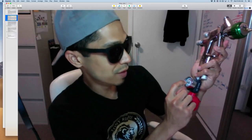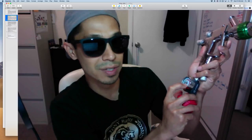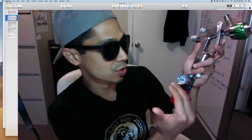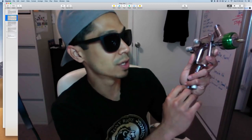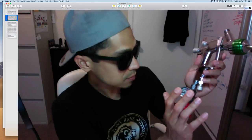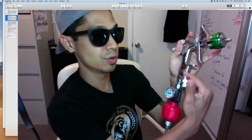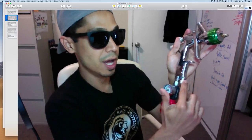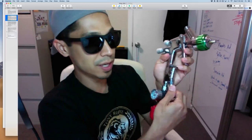This dial isn't the most detailed as far as the graphic goes — the gauge doesn't show you a great read of where you are. You might want to pick up a digital gauge. I'm actually working on a deal with Atom to get a digital gauge included with these guns. The bottom knob here is your main air inlet — keep this fully open. You can adjust air coming in through this as well. For any spray gun — SATA, IWATA, Atom — always keep your main air inlet wide open.